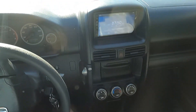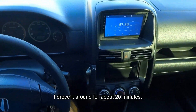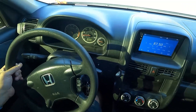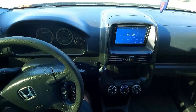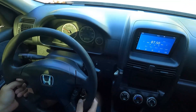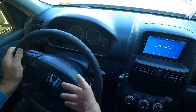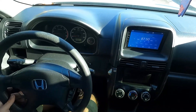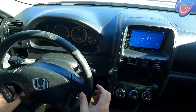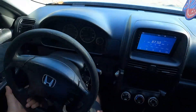We're just going to drive around a little bit more — just want to make sure we've got this figured out before we hand this back to my neighbor. We've got a happy Honda now — no check engine lights on the dash. Now the reason I'm doing a longer test drive than normal is because I was reading forums about this issue and a lot of people said you can really only use Honda OEM parts. Some of these cars are pretty finicky when it comes to the type of ABS sensor you use and even the brand of bearing. I picked up a Master Pro at O'Reilly for the bearing, got the wheel speed sensor on Amazon for about $13, and the harness connector I found on eBay. The wiring on that was aluminum, whereas the original harness is copper — but so far it looks happy.